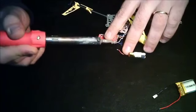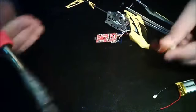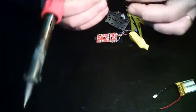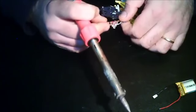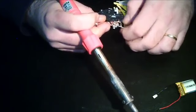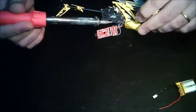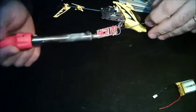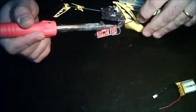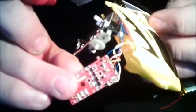This could be kind of tricky, but now it's imperative that you have a hot soldering iron. Why? Because on these kinds of procedures, you don't want to apply too much heat to the wires in the PCB, or you could otherwise burn it, and you don't want that. Now a good thing is to apply a little bit of solder. Keep in mind that these are small soldering points, so you don't want too much solder, just a little bit, in order to have that little blob over there that I just put in.